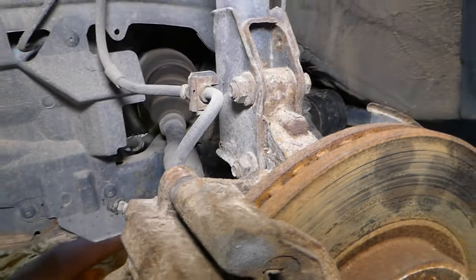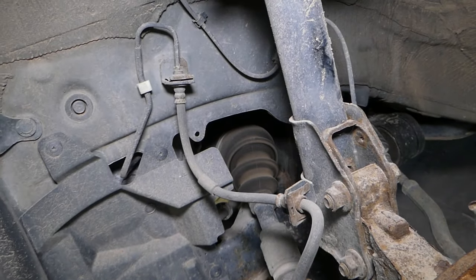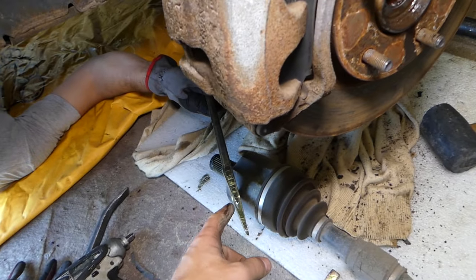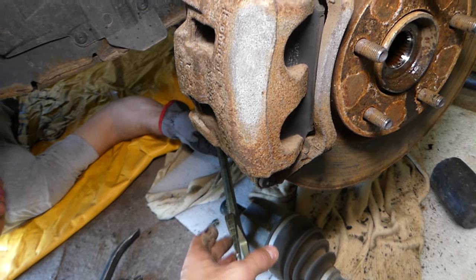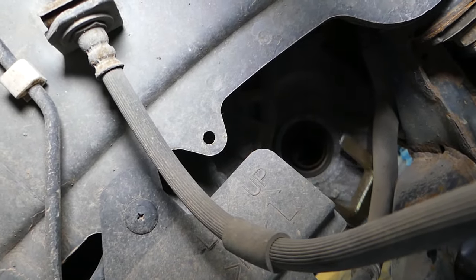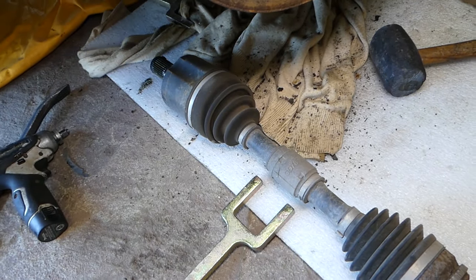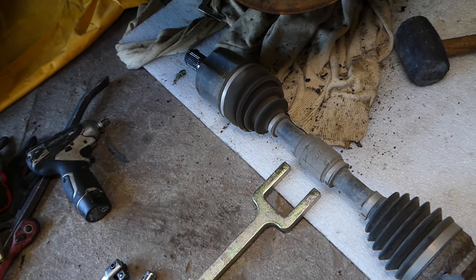Okay guys, and the axle came out. Perfect, this axle, guys, is out of the way. You can see how easy it is with that tool. You just have to be careful not to put too much tension, too much pressure, because you don't want to crack your transmission side here. That's where it goes. In addition, guys, without that tool, it's really hard to remove it, and there is a higher chance to crack your transmission housing. So be very careful. I'll definitely recommend using that tool.